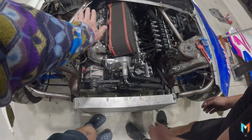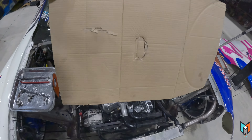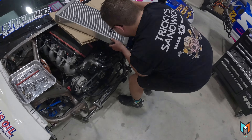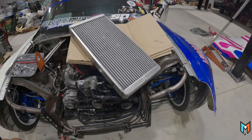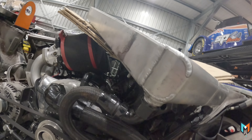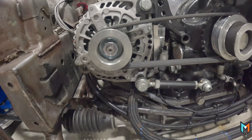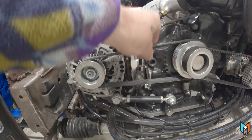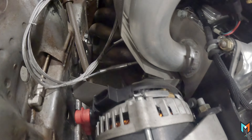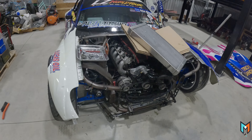We've chucked a bit of cardboard up there and got the oil cooler up. The first time this line here was kinked big time, so Demarker had a good idea - we loosened off that fitting and rerouted it around. Now we're going to pull off this alternator. See there's the tensioning bar down the bottom which will loosen the belt, take the belt off the alternator pulley, get the alternator out of the way, and then behind the alternator is that little heat shield - then we're into the exhaust bolts.